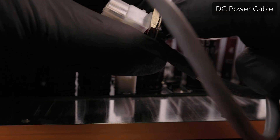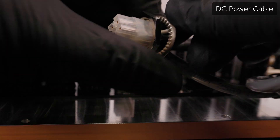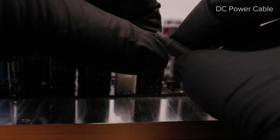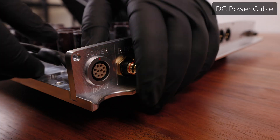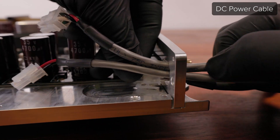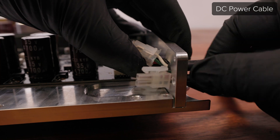Take your time and be careful not to damage the wiring or connector during the process. Now push the DC power connector out of the jack panel with a slight back and forth motion while pushing from the back. Repeat the cable process again to pull the connectors through the jack panel, starting with the two-pin and then each of the four-pin connectors.